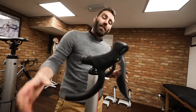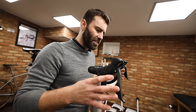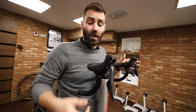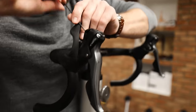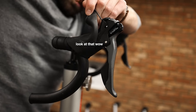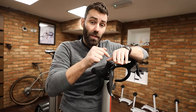The final tip: brake lever reach can be adjusted on almost all modern shifters. This is less important when the handlebar width is already optimized, but it's a particularly common problem for women who tend to have narrower shoulders. On this Shimano Claris lever, you pull the lever back and wind in the adjuster — you can see the lever getting closer and closer to the bar, making it easier for smaller hands to grasp.